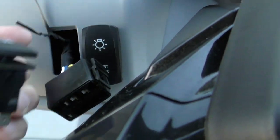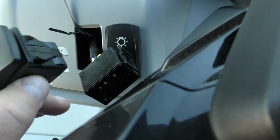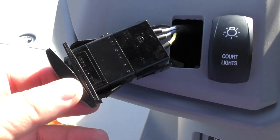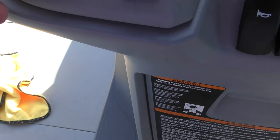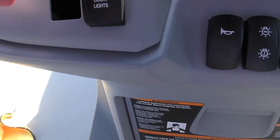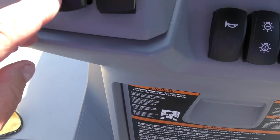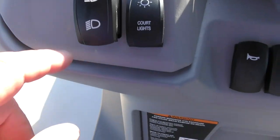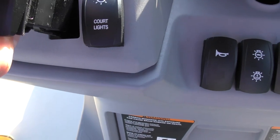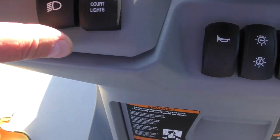The final step is going to be to put the switch together with the connector and plug it in. I'm going to apply some dielectric grease and then plug this in. The two pieces are connected and it's nice and flush. Now insert this and pay attention to which way it goes. This is incorrect — this is correct. You have low beam and then regular beam. If you turn it around the other way it looks like it's a high beam but it's not — that's the low beam. So insert it in this direction until it snaps into place.